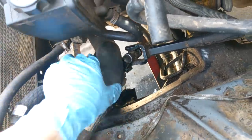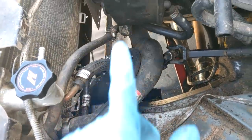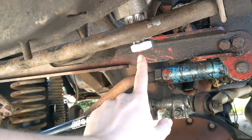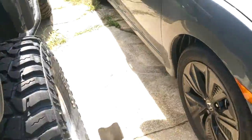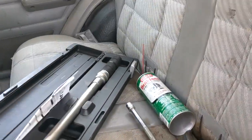See if we can get this radiator hose out of the way so we have a little more room to work. Once we can get that to engage, we can put our bolt on and then bolt the whole thing in. When we finally get to put the Pitman arm on, this is 185 foot-pounds. Oh yeah, that's a monster. Glad I got a monster torque wrench.